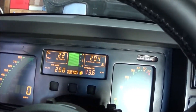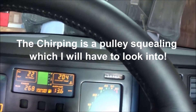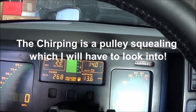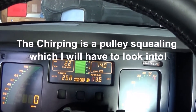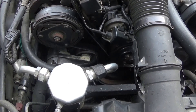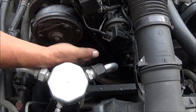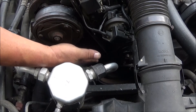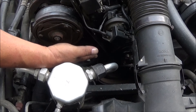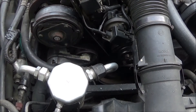We're still doing good. Oil pressure's a little low, and we got working bolts. The idle pulley — its bearing is going. It's actually squealing really badly when we start up the engine, so we're going to replace that idle pulley with a new one.